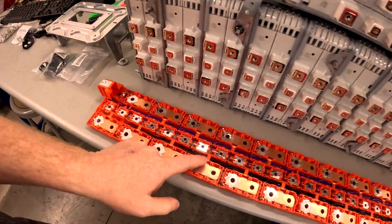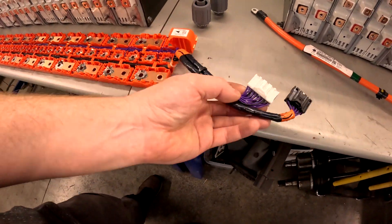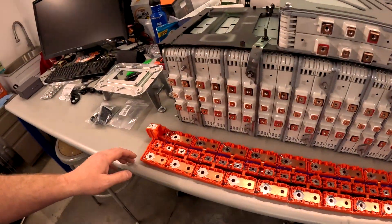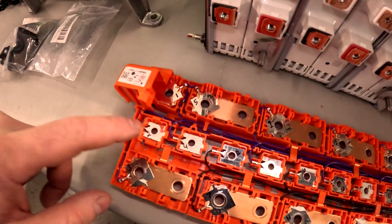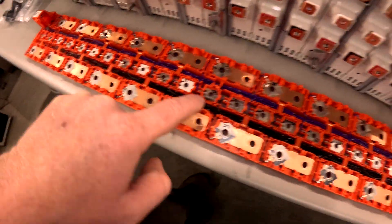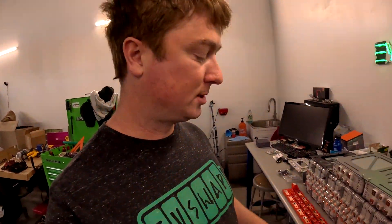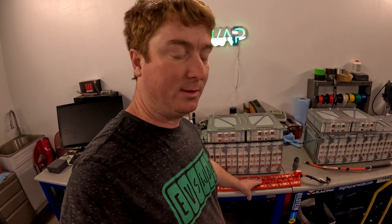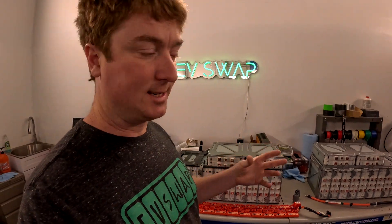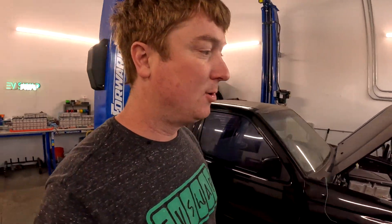Another tip if you're a DIYer pulling apart a factory Nissan pack or any other EV pack: each one of these small-gauge wires goes to the BMS. These are what they call cell taps — this is how the BMS knows the voltage of every single cell. There are 96 cells in this pack, and some packs have even more. What I've done is marked numbers one, two, three, four, five, six, seven, eight, nine — all the way through on the bus bar. When I transplant this into the new battery box, I can line up these numbers exactly on every cell in the correct order, so I won't have to worry about the wiring — it'll be really quick and simple.